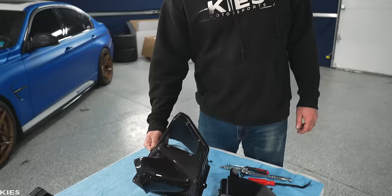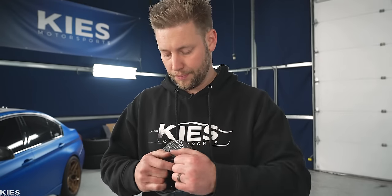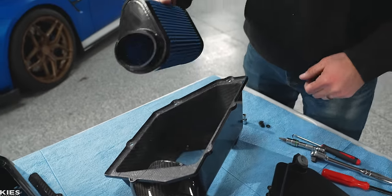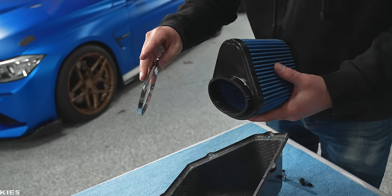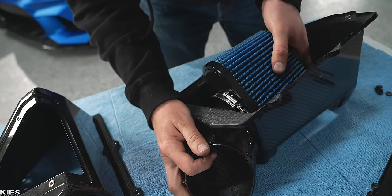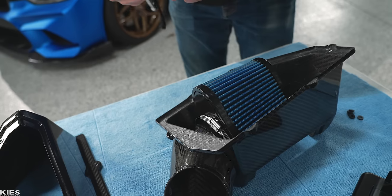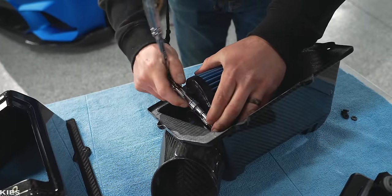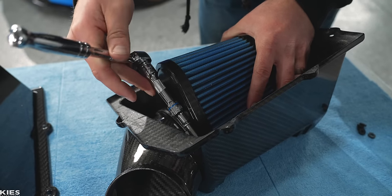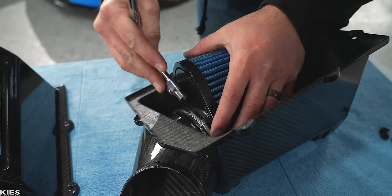Now take a look at which carbon top you're going to need. I'm going to need the driver's side over here. Flip that over and grab one of the air filters — it's an oval shape and is going to slide on so that the larger portion is facing down. Before doing that, make sure you put a clamp on here. It should slide on with relative ease. Then tighten the hose clamp down — I personally like to use a 7mm, but a flathead or Phillips head works too. Just be mindful you are tightening this on carbon — you don't want it to crack, so just snug it up, don't go crazy.